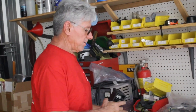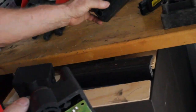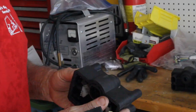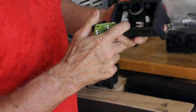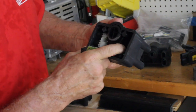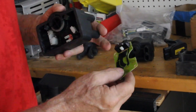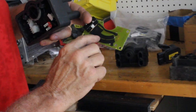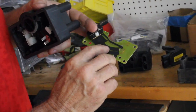I cut open one of these boxes to show you what's inside, which you normally don't see since these are sealed units. There's a circuit board inside, and a rod that goes from the gas pedal to here. So when you step on it, it moves a lever, and that lever rakes across the circuit board — that's your speed control. These little tines rake across whatever that coating is, and when they fail, they wear out and cut little paths in there. That's where you get your hesitation.